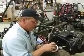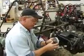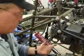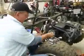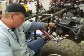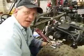Now we've got all six DR pulley sliders back into the stock variator. Put your top back on, make sure you've got your boss pin back inside, and slide it back onto the shaft. Put your drive belt back on, put your fan back on the outside with the splines lined up, then your washer and bolt. Put your cover back on, and don't forget to put the wire back on the Phillips screw you took off — if you leave that off, she will not start. Then take her out for a spin — I think you're going to like the change.